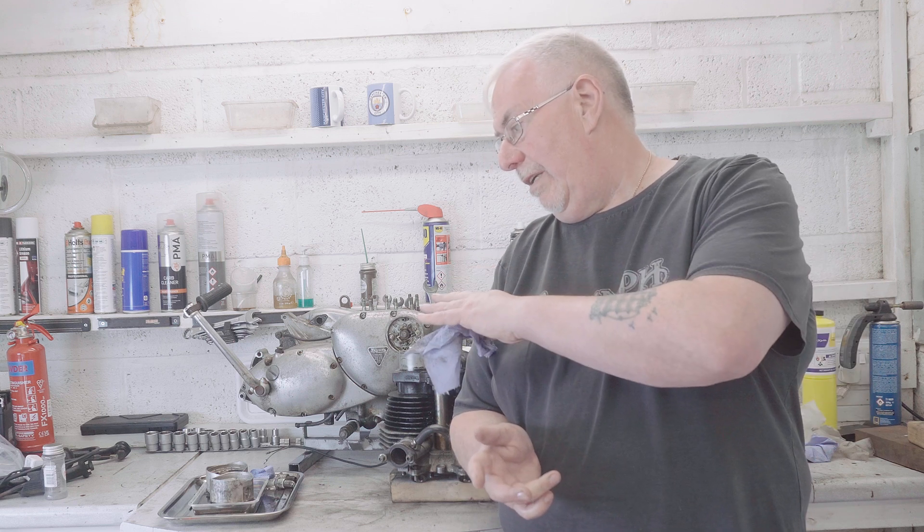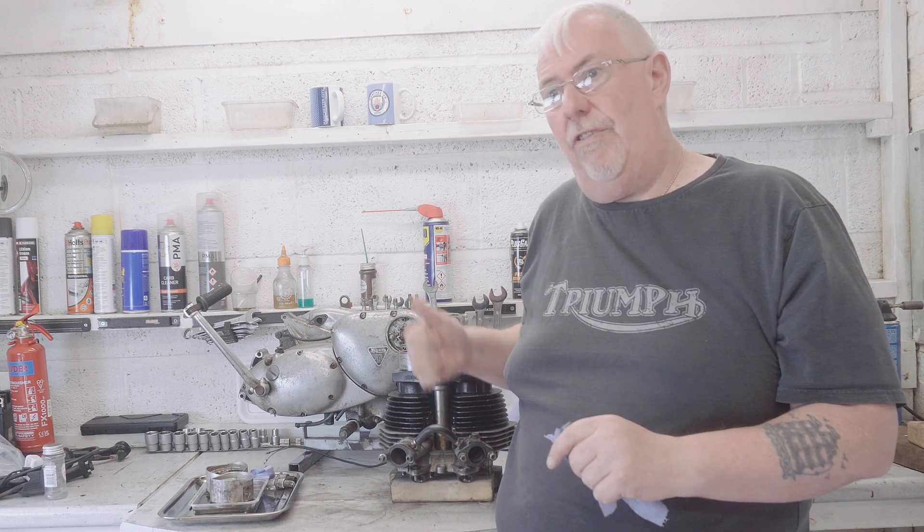I think these barrels and pistons are good to go. It does look like the pistons and barrels were bored not that long ago, although there's a lot of carbon on the top of the pistons — I think that might have been poor running. So if the barrels and pistons were not stuck to the head, I'd be very happy to use them, and probably will if I get them off eventually. I think I'm going to stop there — the next thing I'm going to do is have the timing chest cover off and the primary, and have a look inside. I also need to get on with the frame; the sun's come out reminding me I should be giving it a wash and getting it stripped ready for painting before the rain comes again. Thanks for watching — hope you found this interesting. Why not subscribe to see what happens next?